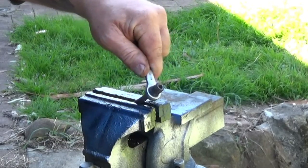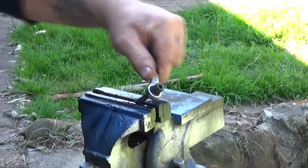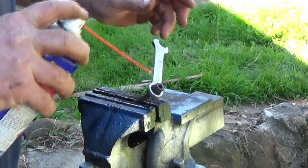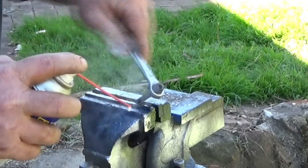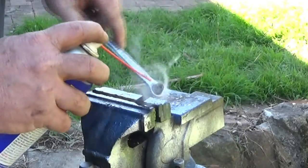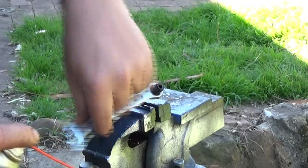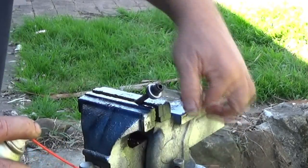You've got to be gentle, but that's already starting to turn. That's starting to loosen right up — turn the heat off and hit it with some WD-40. You're going to smoke a bit, but as it cools down it'll start letting it in. And there you go — unstuck. The more you work it the looser it's going to get. I just wanted to show you how I did the other ones, because you might get stuck like a lot of people do with these things that don't undo, especially on old cars.